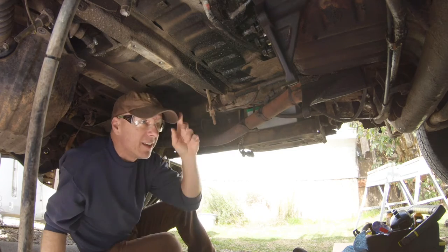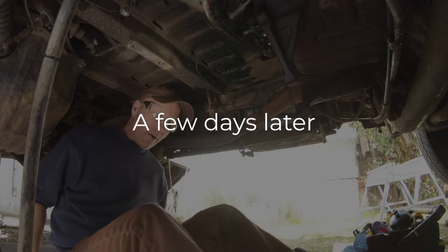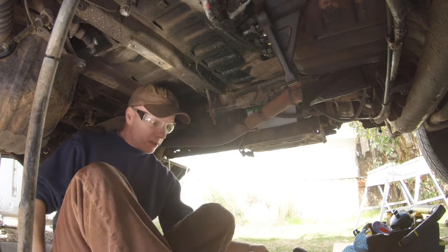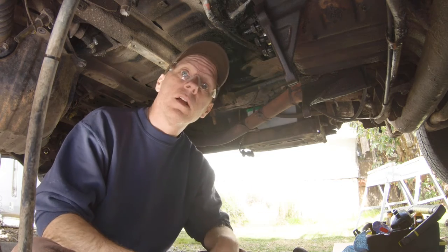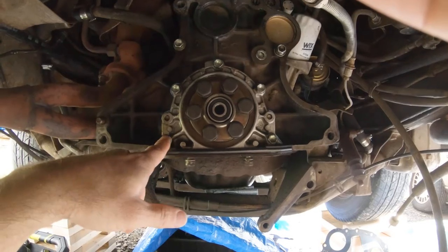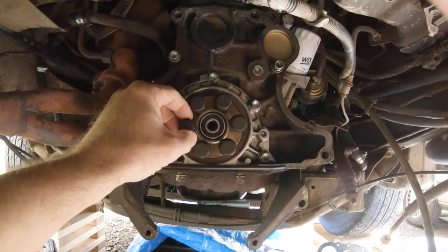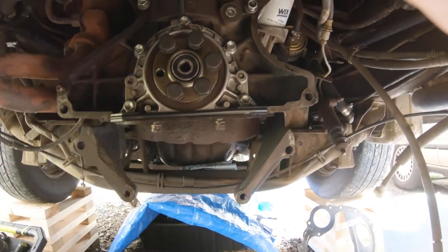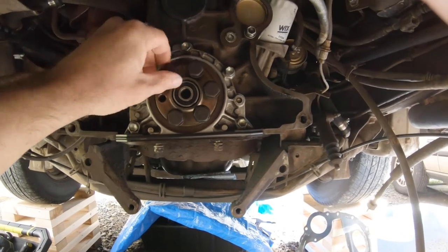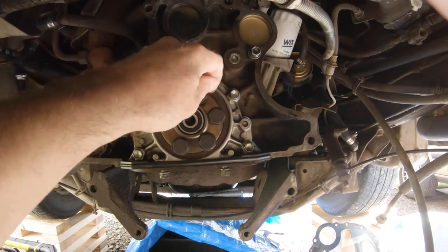Well, I don't feel like being under here but I don't have much choice being that we've got good weather. I'm gonna try to see about putting the rest of this clutch back together, so we'll see how it goes. I've got the seal all in place and I've got my flywheel bolts. I'm gonna yank these guys out and get them ready to reinstall because my flywheel got turned and it's in beautiful shape.